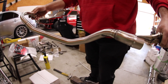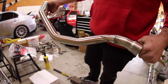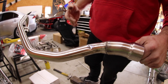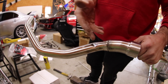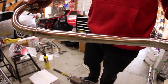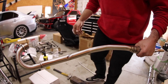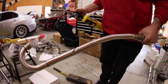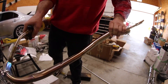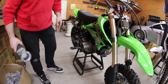So I polished out my two dents. I got one right here that looks disgusting and I hate that I had to do that, and then I've got this one, which is minimal and fine. To not throw Rocket under the bus, this dent may not have even been necessary — I saw it on the FMF and assumed it probably had to come here too, but it's a brand new header. Had I realized this dent needed to be here first because of my unique clutch cover, I probably could have saved myself the other one. Unfortunately it's already there, so let's burn it. Time lapse — you can see the color go into it pretty quick. I'm going to take some material off this cover before I even put the header back on.